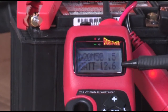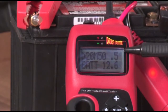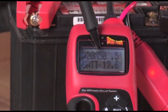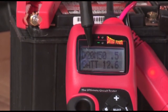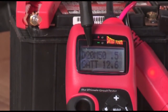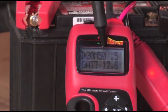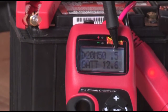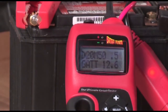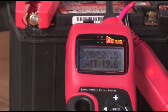Let's take a look at the display. Battery source voltage is displayed on the bottom, and the preference line is displayed on the top. Take note of the speaker symbol: 20, M, 50, 0.5. The circuit breaker is set to trip at 20 amps, the power switch is set to momentary, the AC threshold is set to 50 volts, and the LED voltage drop is set to 0.5. These are factory defaults, but all preferences can be customized and saved.